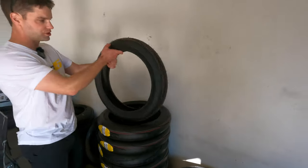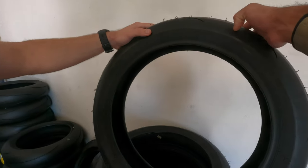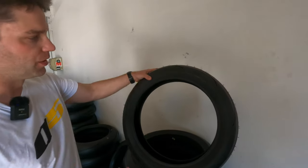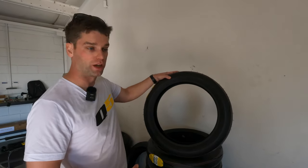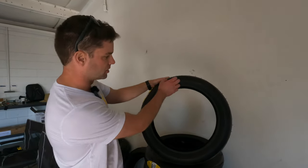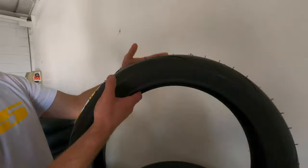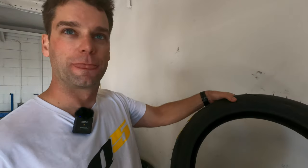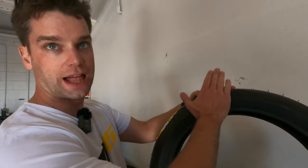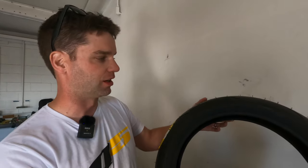This is our 120/70 — this is the new front. The first thing you'll notice when you pick one up is it feels a lot softer at cooler temperatures before you get to operating temperature than our older tires did. We focused a lot on cold temperature performance without losing anything in the heat of summer — making sure these tires warm up really quick. You'll also notice a taller sidewall on here. The tire itself is a lot taller, and that's going to give you more grip through the corners — really increase your surface area in contact with the ground, especially when you're leaned over.